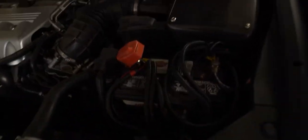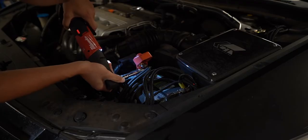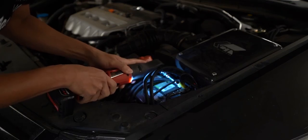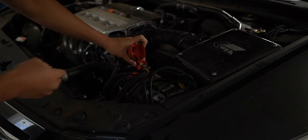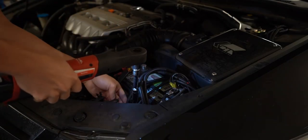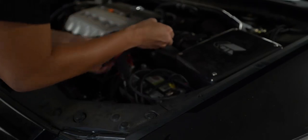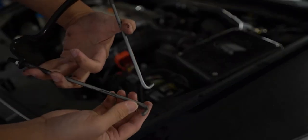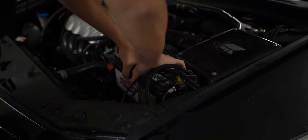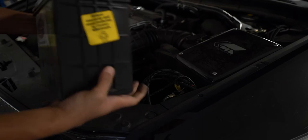And yes, I know I need to clean up the battery cables here. Right now I need to undo these bolts here, the J-hooks. Should be as simple as removing it, taking out the battery, putting all the wires aside, and that should be it. Fully take out the bolts holding the battery terminal. Then I'll go ahead and remove these guys here. That's the tie bar right here, the J bolts, on the underside of the hoop. That's it, you got your battery out.